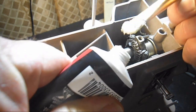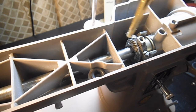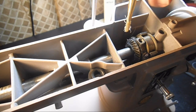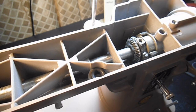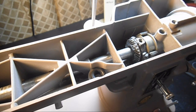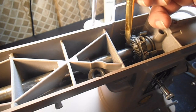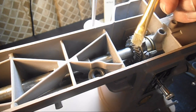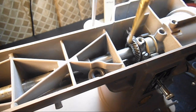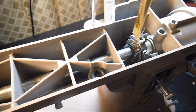I'll get some more on here. In the end, all the extra grease that slaps around, we're going to wipe it off with a rag or a Q-tip. But we want to get grease on there right away to protect it. No oil on gears. I have seen people put grease on other parts, and I disagree with that — it's up to you. Oil on bearings and bushings, and grease on metal gears. I have never put anything on any plastic gear — no oil for sure and no grease. Just keep brushing that in and spinning it, scooping it up and putting it back on there.